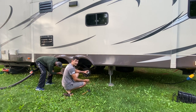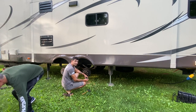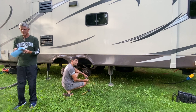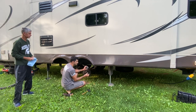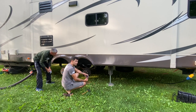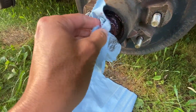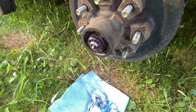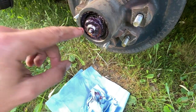I literally was just telling my dad I had dreams that this would happen. There was no way of knowing until you go to take everything off. If you have Easy Lube greased bearings — which I do — meaning there's a Zerk fitting sitting right on here. This little rubber seal pops off your dust cover so you can just hook the Zerk up and pump the new grease through. We're going to show you what that process looks like, because originally we were going to repack these bearings by hand, and now we don't have to. You can see this little Zerk fitting right there, and right on the cap was this rubber gasket that says 'Easy Lube.' That's what you look for to know if you have a Zerk fitting underneath.